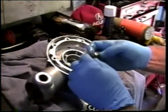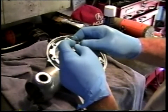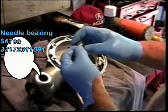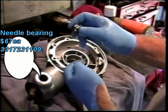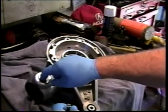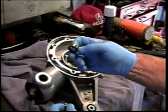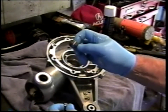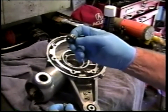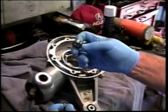I noticed on this drive, looking at the pivot bearings, that there is notching on these pivot bearing races. So consequently, I would decide to replace these bearings prior to installing this drive on another bike. I should note that somebody posted a while back on the website that they had noticed in the final drives that they had looked at a high incidence of indications of wear on these pivot bearings. So it is apparently a known early wear item.